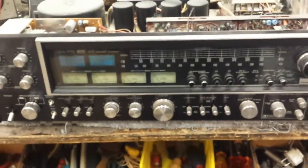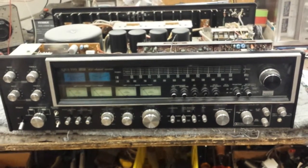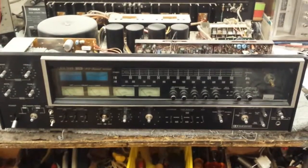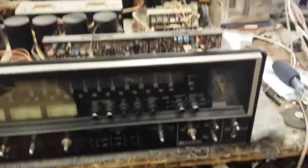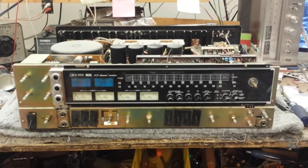In order to get to the four-channel board, the entire front of the machine needs to be disassembled. I'm going to do that step-by-step in abbreviated form. The first thing we're going to do is take all the knobs off and then take the faceplate off. Now that you've got the knobs off, there are hex nuts here, here, and here which need to be released, and then there are three screws on the top. Take those out and that will give us access to the faceplate. Here's your set with the faceplate off.